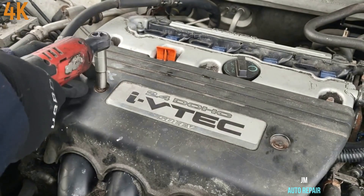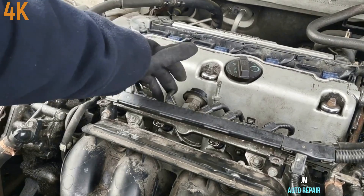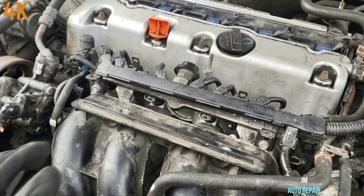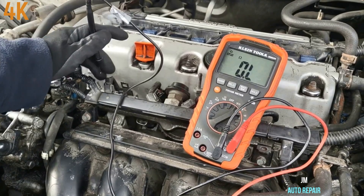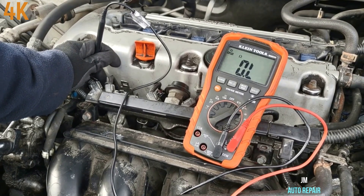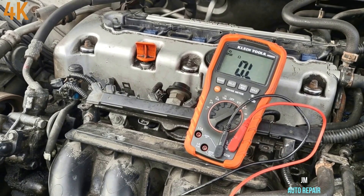The next step — I'm gonna be removing this cover. This is injector number one and I'm gonna be exchanging them. Now it's your own decision to either check injectors or do a compression test — it's up to you. I'm gonna be checking the ohms on pin number one and number two of the injectors. I'm supposed to get between 10 and 13 ohms. If I get those readings, according to Honda, the injector should be okay. 10.8 — that is good. The injector is within the specification from Honda.